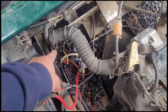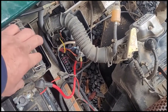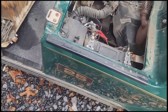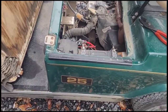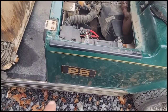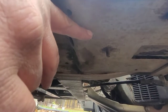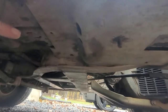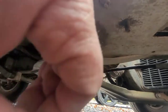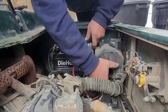To do that, get yourself some pliers and get that spring clamp, pull the duct off, remove your filter. Your cart might have Phillips head screws or it might have 8mm hex head — mine has 8mm hex head. We're going to get right down under where that 25 is. There's one there, one back here, there's one there. Pull those three out, it should pop right out. Those were 5/16ths fasteners.